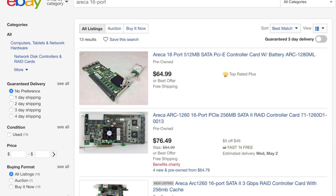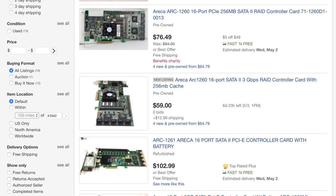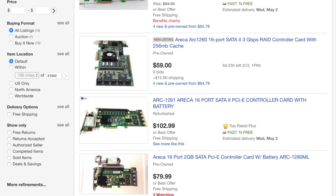You can get reasonably low-cost RAID cards if you look on eBay. Find a decent RAID card manufacturer and go a few generations back — enterprise-grade hardware from several generations ago is still fine for RAID cards and HBAs when you're just plugging in SATA hard drives. You don't need blistering speed or SAS or 12 Gb/s; you're just dealing with hard drive speeds.